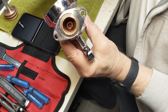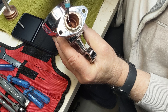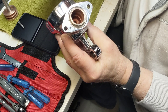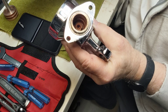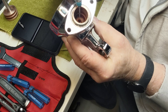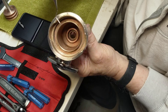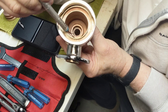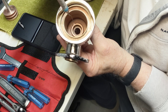I'm going to try to show you why the boiler isolator is important. If you look inside the system group head neck, there are three holes in here — two right in the middle where the fill tube goes. The water comes into the fill tube, through the boiler, into this fill tube, and gets inserted there. In here there are also three holes — these two holes here — so when the piston gets lifted all the way up, maybe I can show that later.